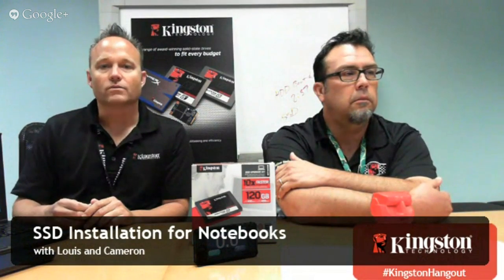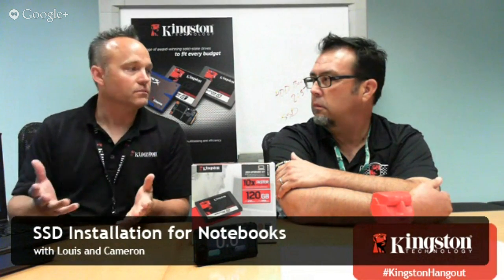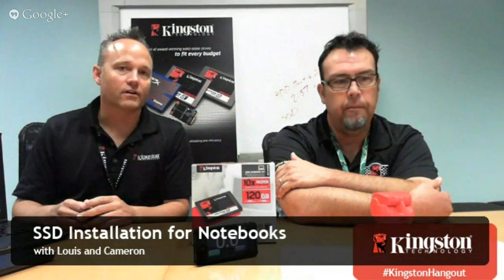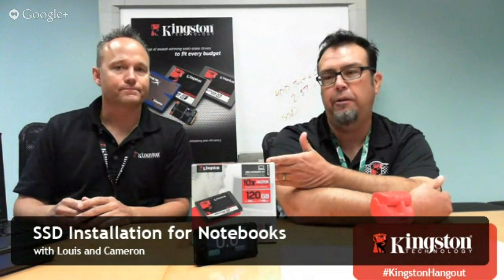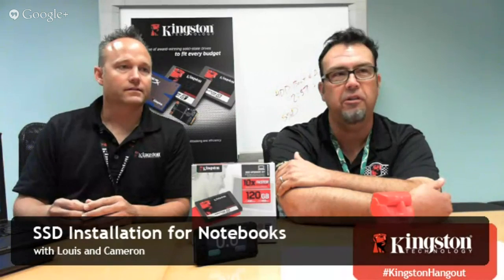Yeah, we sell not only to the consumer space, but also to the corporate space as well, and we see a lot of our customers extending the life of older systems by simply moving to a solid-state drive. The beauty of serial ATA is it's backward compatible. So systems that were built in the last 8 years can use the SSDs that we're shipping today. And even an SSD running at SATA 1 speed still stomps a hard drive. So you still get quicker boots.